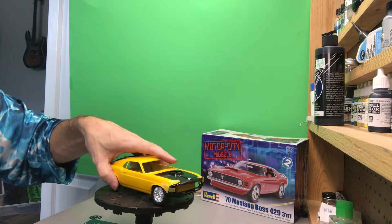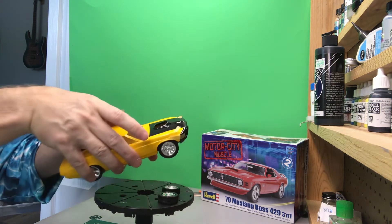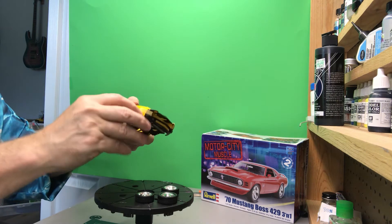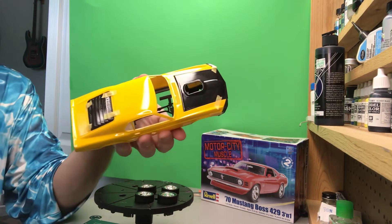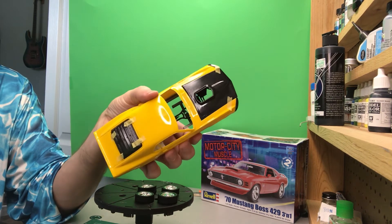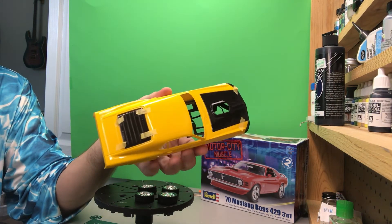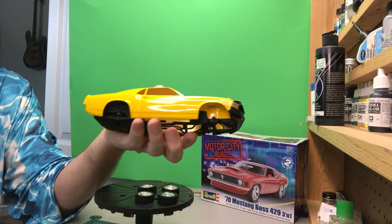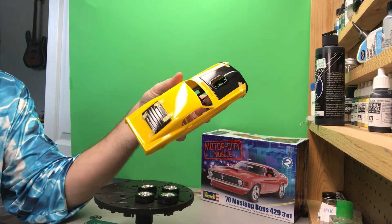The body still needs to be wet sanded and polished out. I did go ahead and put some clear coat on it. Before I clear coated this with the extreme lacquer clear coat, I did have to wet sand this down because there were some areas on top and back that needed to be flattened out. That was wet sanded up to 12,000 grit and then cleared. I will go back and wet sand again — there's just a little bit of orange peel here and there that needs to be sanded out. Then I'll buff and polish with my Nova set.